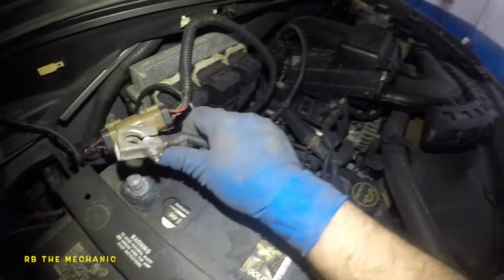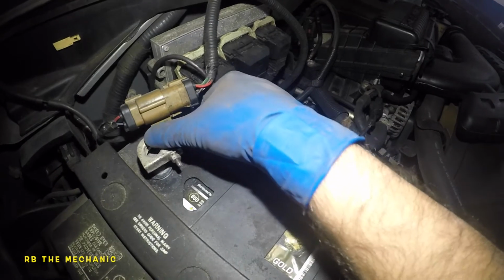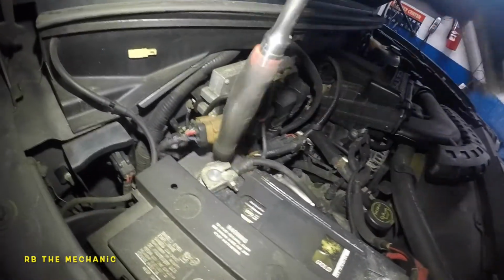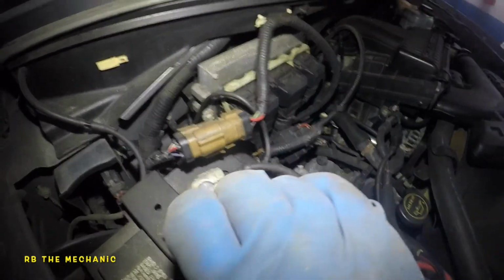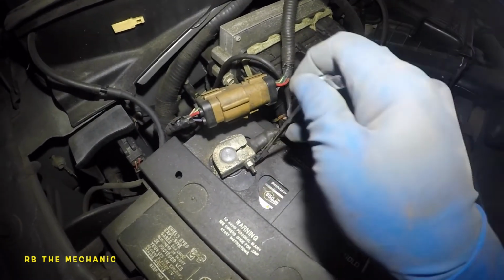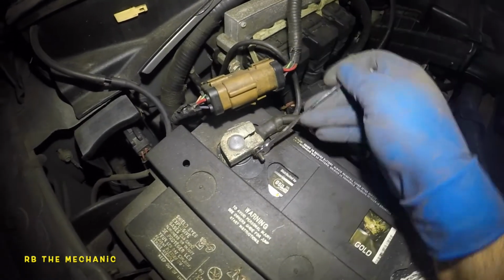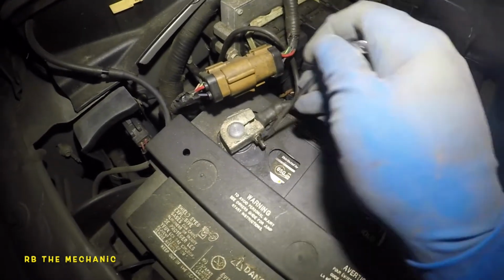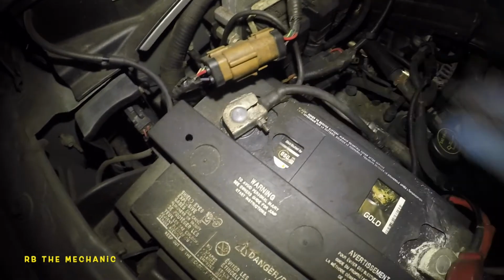Sometimes when you put this cable on, your alarm might go on. So make sure. And I'm gonna tap this a bit with something. I just want this to be down as much as possible. Okay, so that's that. Lock this baby up. So this is the first step, okay? Disconnect your battery, so there's no power on those cables down there. It's not gonna shock you. It's just that if you touch it to the body, it's gonna short circuit. Like I said, it's live power down there.